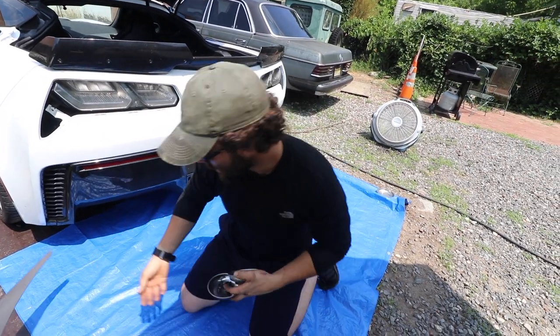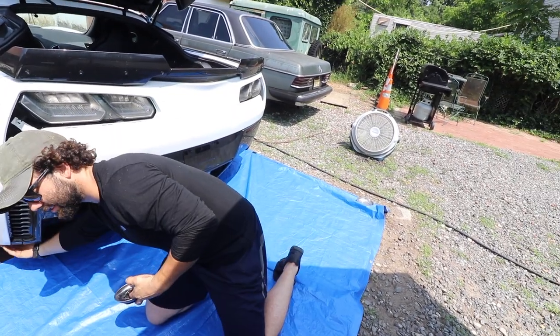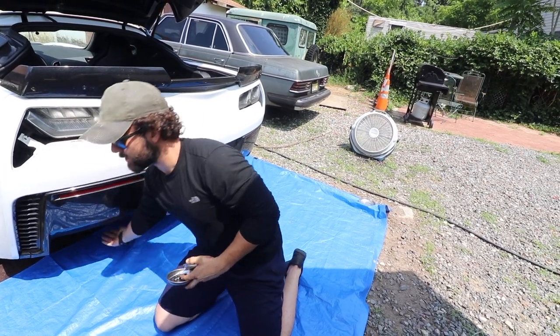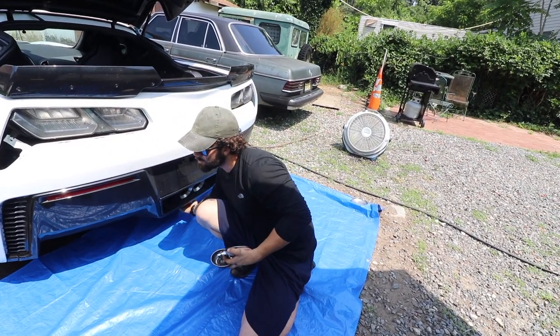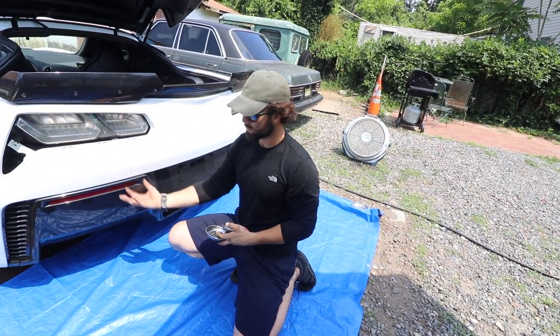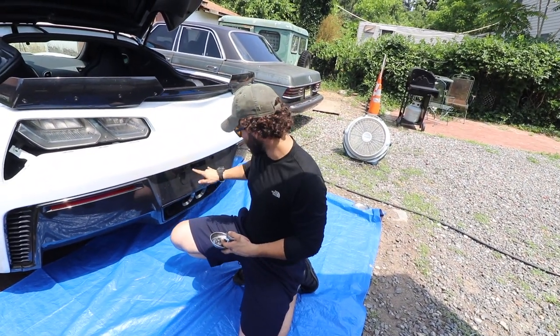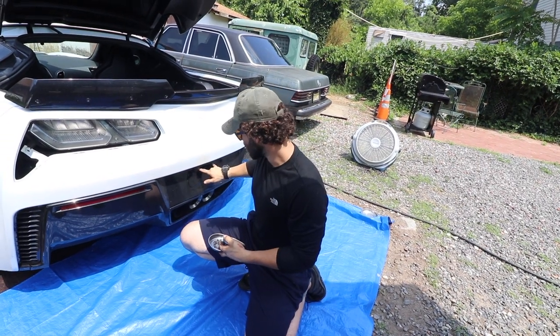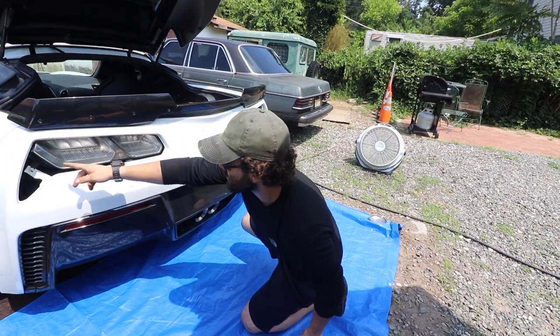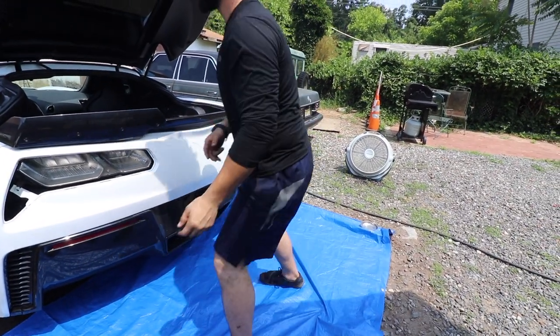After you pull that off, you got a seven. I had a 7mm and a mixture of seven and eights down here. There's two there. You're just detaching the diffuser, because the diffuser is connected to the bumper, but the diffuser is connected to the subframe. And then you have the license plate bolts right here. And then to the exhaust, there's two tens. And then there's another Torx inside. I yanked out that other side.